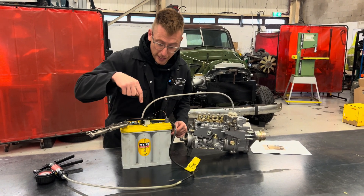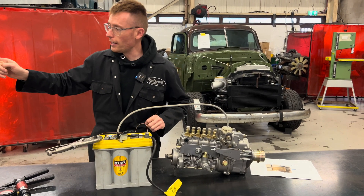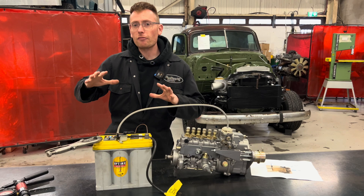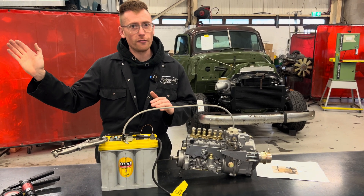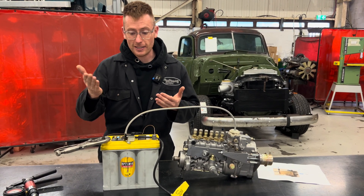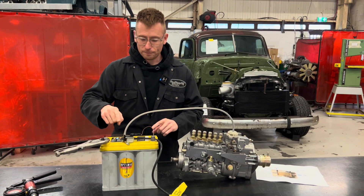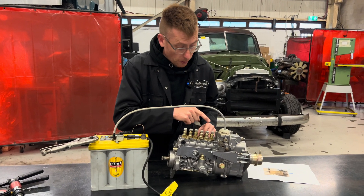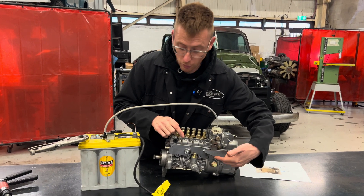The vacuum is coming to here, to the valve, but going no further. Because you've got to imagine, while that engine is running, you can't have a vacuum leak — you can't just divert it to a vent because you'd have no vacuum for your brakes. So it has to seal the path where the vacuum is coming from. The vacuum goes to the pump, but there is no vacuum currently going to the pump because we can see the lever is fully forward.